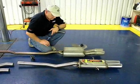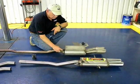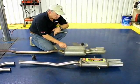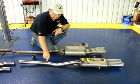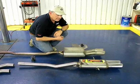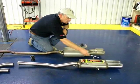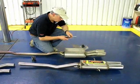Looking at the rear muffler design, the factory rear muffler design has a single pipe going into a short Y pipe. That short Y pipe enters two single pipes inside the rear muffler. Supersprint system has a single pipe going into the rear muffler, and it has a Y section built into the muffler that is a longer Y section for smoother flow transitions.